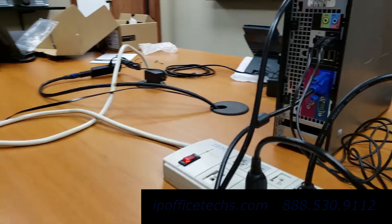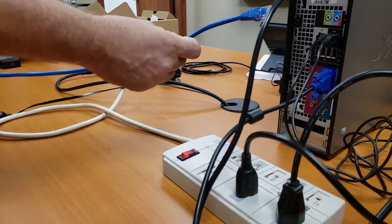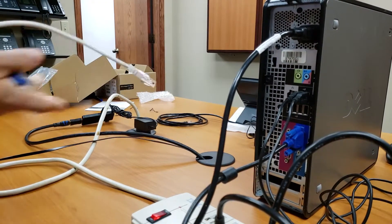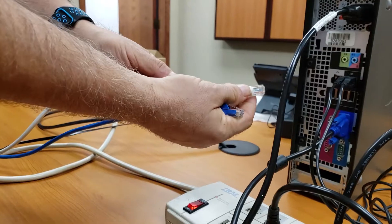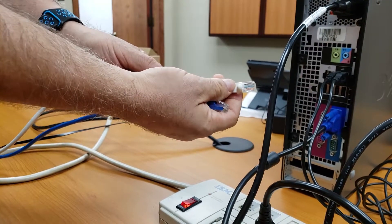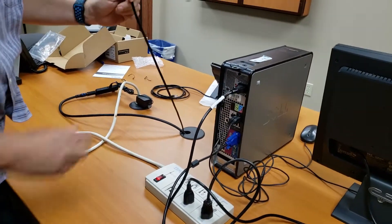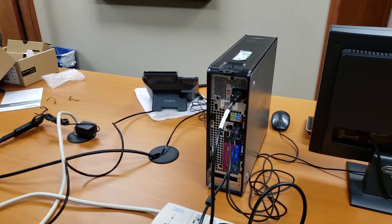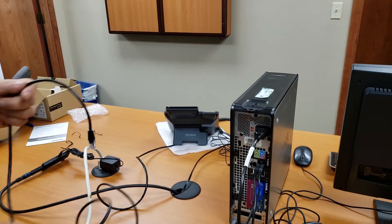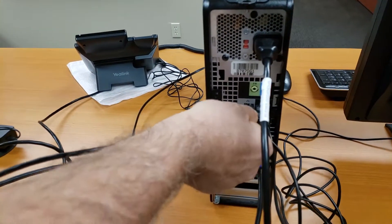There's a chance that your ethernet cable might look a little bit different. It might be a blue cable with a clip that you have to depress to pull it out, or a white cable, or pretty much any other color. Sometimes there's a little protector piece, and you've got to be careful to make sure that's pressed before you can pull it out. Now the cable that we took out, we're going to put over by our phone. Then I'll take the black cable that I plugged into the phone's PC jack and plug it into the jack that was vacated by the wire we pulled out earlier.